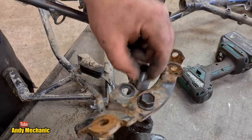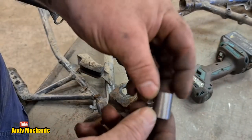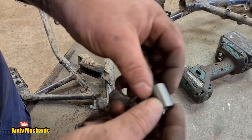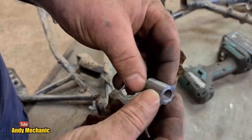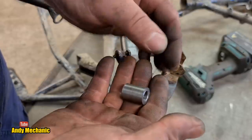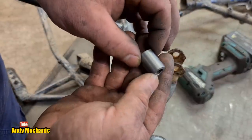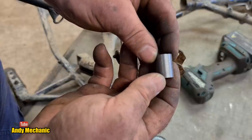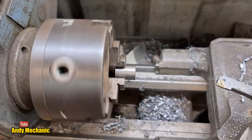Holy crap. So, if I bevel the end here, it'll drop further down. And then we'll redo that measurement. I don't want to take 7mm off this. I want to keep as much thread depth as I possibly can. So I'm just going to basically chamfer the end of this so it'll drop further into the tube. And then we'll take another measurement and then do the final face off to get the right length. Oop, wrong way. Donkey.